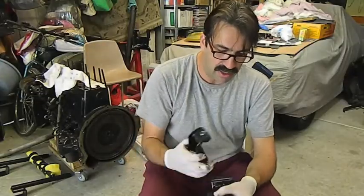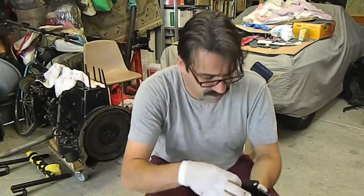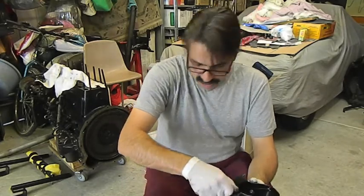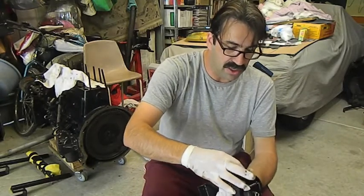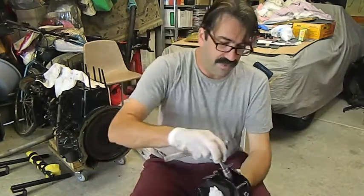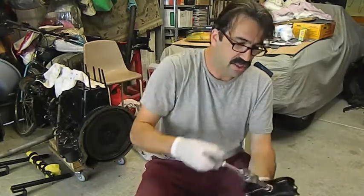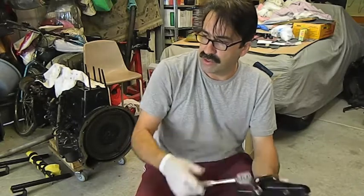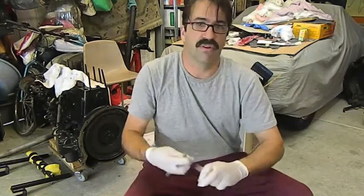I've shimmed this. New mounts here — these aren't new, they're from the chalk shed and they're in remarkable condition. This is the driver's side mount so I can't mount this on the engine just yet. I have to wait until the engine is about to drop into position and then secure this to the block, because it has to clear the steering box. I was going to try putting the steering box in with the engine, but I've not done that before. I thought I'd play it safe and do it the way I've done before — it's a bit more fiddly, but it's proven.